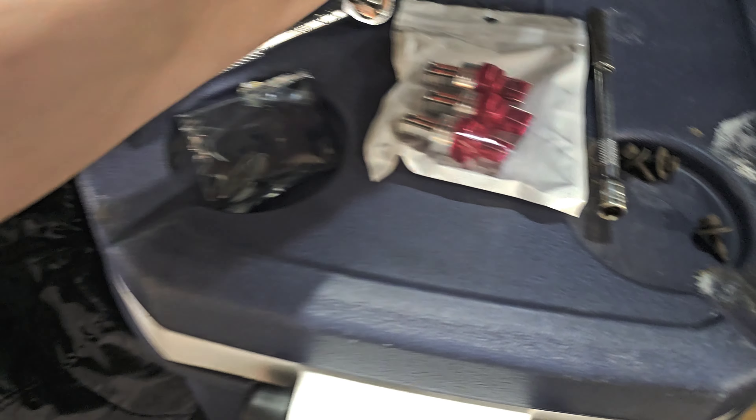Line it back up on the nub and slide it back in. Okay, we got it in reverse so we can see the reverse light is working — look how much brighter that is. You can see the brake light flash, so the brake light is working. To get your taillight back in, you're going to want to line these two little nubs up with their holes. Once you get those lined up, you just push it in place and you'll feel it pop right in. Then take your screws that you pulled out — I find it easier to put them back on the socket and thread them in by hand first since it's deep in there.